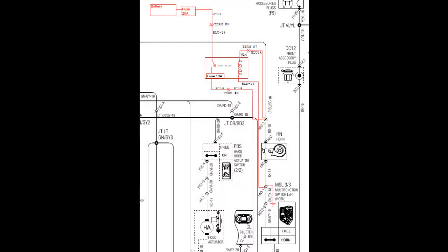Let's take a look at this circuit. On most motorcycles, the horn button would go directly to the horn, and the other side of the horn would go directly to ground. The Spider is a bit different. You have the horn button going directly to the horn, but then the ground side of the horn actually goes to the cluster, then it goes to ground. So if you take the ground side of the horn and put it directly to ground, that horn will blow continuously.